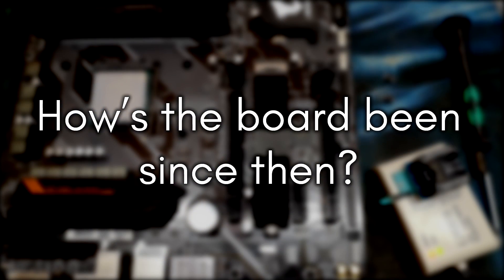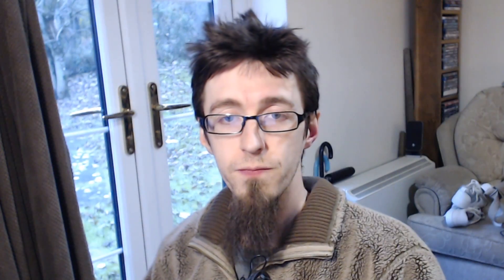So in desperation I swapped over the BIOS chips, hoping that the backup BIOS would be stable, and by pure fluke it was stable enough for me to flash up to F41, which put the board into a stable condition with the 3600. Since doing the review, this board has been perfectly functional and I've used it for loads of hardware testing.